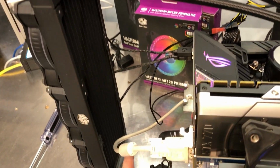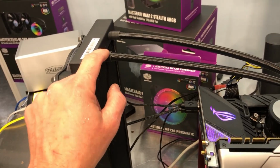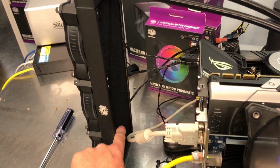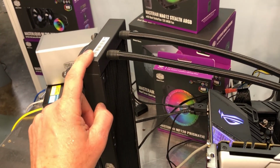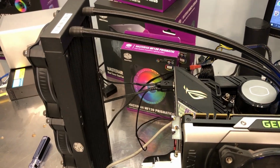It goes all the way down, gets to the bottom down here, makes a U-turn and comes all the way back up. Of course, it should be cooler because it hasn't just traveled 360, it's traveled 360 and then over and back. So 360 millimeters twice to get your coolant temperature lowered.